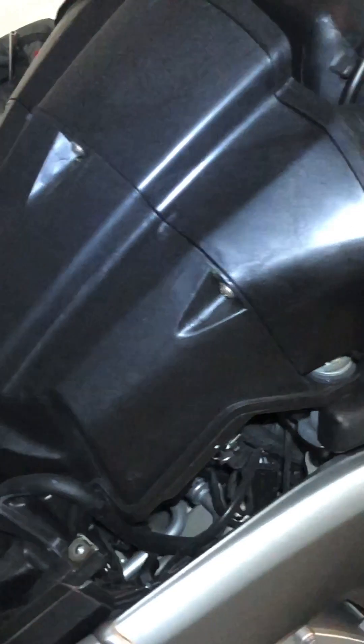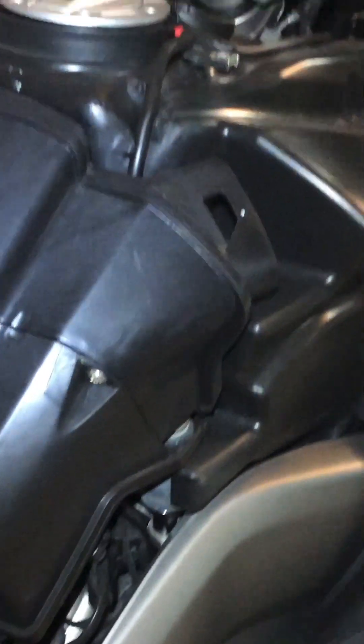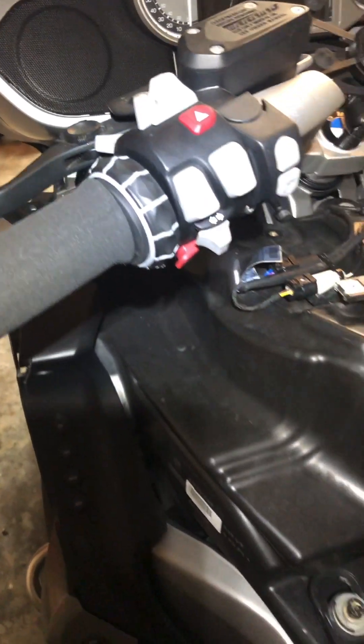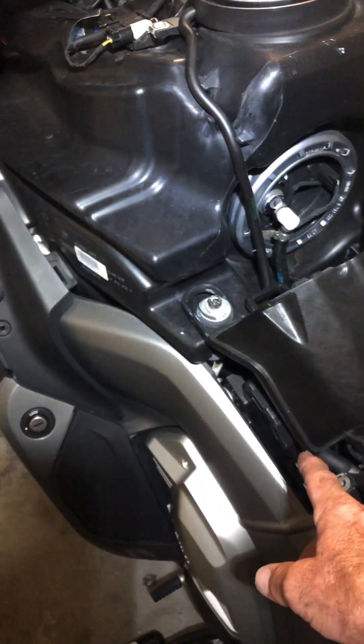So now we can gain access to our air filter, and also I want to remove the airbox and replace the reverse module that's in there that's gone bad - and now I don't have a reverse. I got my airbox apart and it's laying right over there. The filter does need to be replaced. It basically just unsnaps from this little clip right here, that little nozzle - it's your little cold air intake system there. I need to remove this because the reverse control module is supposedly underneath there, so I'll probably start by taking these clips off right there.